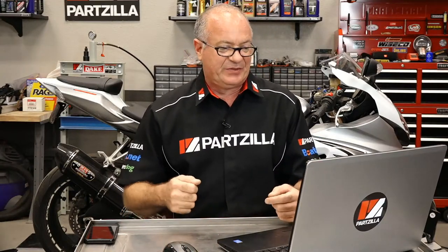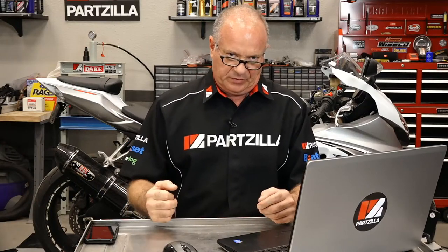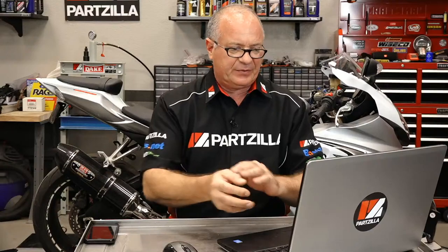All right, Isaiah is asking, oh, we tried an air hammer, still nothing. Sometimes just that instantaneous hit is great for breaking loose nuts or bolts or screws, and that's what an impact type device is really made to do. But what you're looking for is sustained pressure to force that pin out.